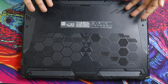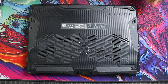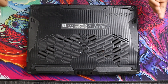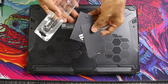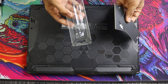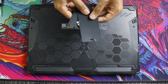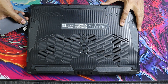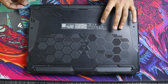Now you will need something strong that is made out of plastic to pry the laptop open. You can use your fingernail but I'm not going to. What I'm going to use is some cards from a clothing company and a thermal paste box. Please don't use anything metallic at this point — use something that is easily bendable but also strong. Go ahead and insert the plastic pieces into the corner. This might take some strength.